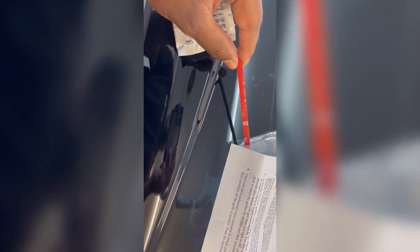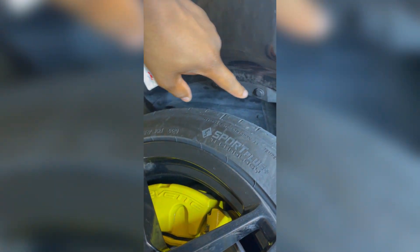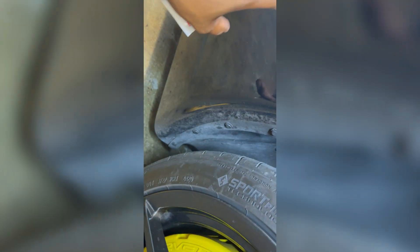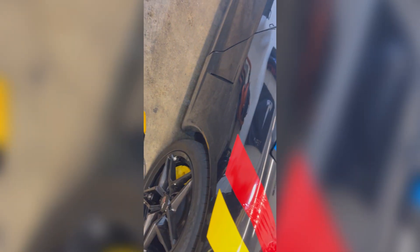Basically, you're supposed to alcohol the inside of the grill area — I'll show you guys that here in a second. And then you also want to take off the 3M adhesive tape, tap a little bit of this adhesion promoter on there, and then put it through. One thing I did differently from the instructions is that you can actually jack this car up, remove the wheel, pop out these tabs right here, remove this, and then push it up in there. You kind of want to hold it for around 20 seconds. But this is the method I use.